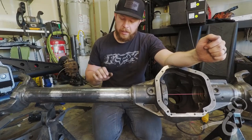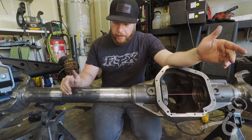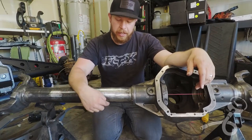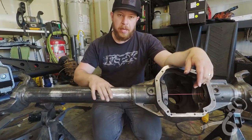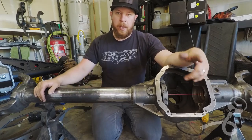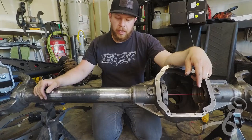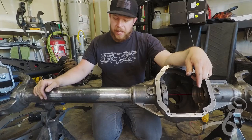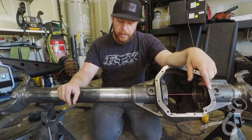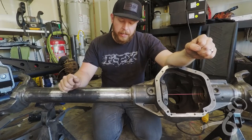Alright, I wasn't sure that this was going to actually work super well, but it seems like it worked just fine. The lessons I maybe learned is, if you're going to put your welder at level bajillion, just maybe do like 3 beads, stop, let it sit for about 10 minutes, then do 3 more beads. It still works fine, everything works, it just maybe got a little smoky in the gun, which can't really be a good thing. And then with the grinders, when I was grinding this away, they got pretty hot. I was dual wielding, not at the same time, that would be really intense.